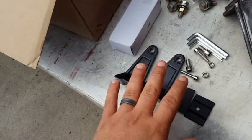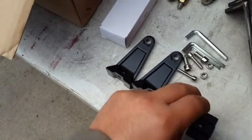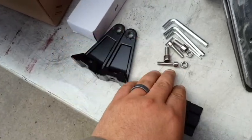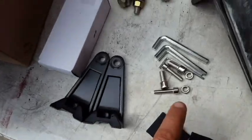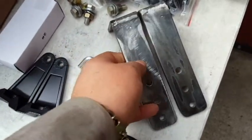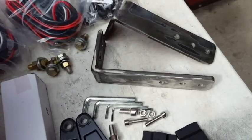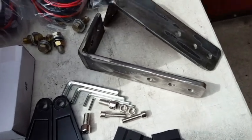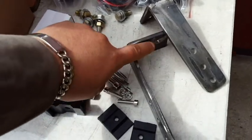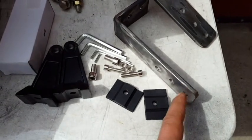For the 22-inch light bar, when you order it you get mounting brackets with rubber grommets so you don't do metal-to-metal — it protects against hard vibrations and keeps paint from getting damaged. However, I modified some custom brackets, similar to the ones I made for the WRX in my previous video. I used one-and-a-half-inch flat bar, drilled a couple of holes for bolting up against the bumper frame, and brought it out roughly six inches.